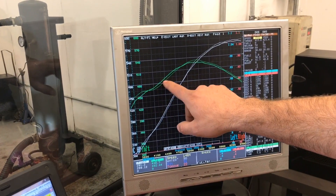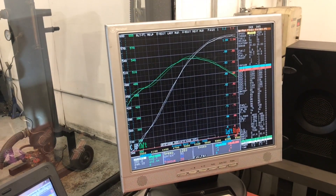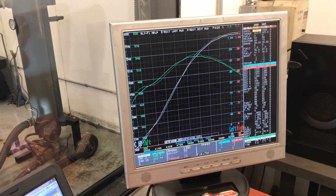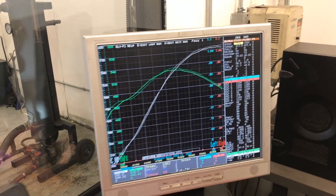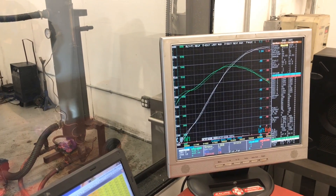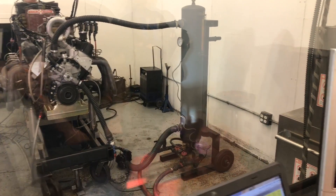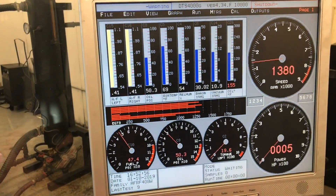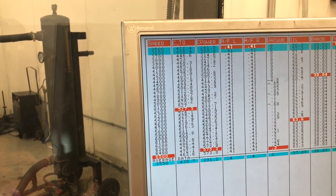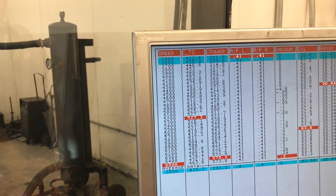As you can see, we made a little bit more torque down low, about the same peak torque, and the graph lays over itself pretty well. So it's safe to say that with this camshaft, there's not much of a difference between the Holley Hi-Ram and the Super Victor Junior intake manifold with the 102mm throttle body. We'll probably see more of a difference with bigger cubic inches and a bigger camshaft — we'll look at that on the next cam change. Here's the tabular data: 527 foot-pounds of torque at 5,200 RPM, and 575 horsepower. As you can see, it just carries it — stays pretty flat there at the higher RPMs up to 6,500 RPM.